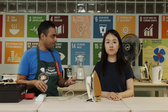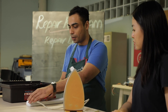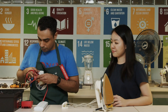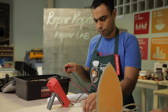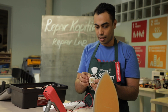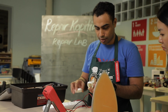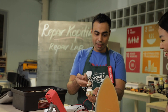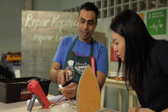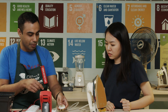Since there's no power, let's start with the simple stuff — let's start at the plug. All our plugs here usually have a fuse inside and in this case the fuse is fine. Wait — I was too eager on the fuse and I forgot something very basic. I can see the live wire here is broken. I wasn't attentive enough in the beginning. The problem can be much simpler than the fuse.